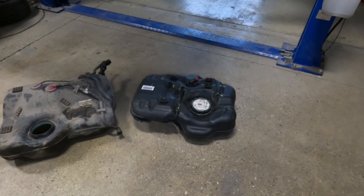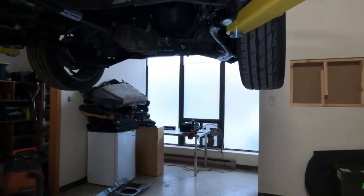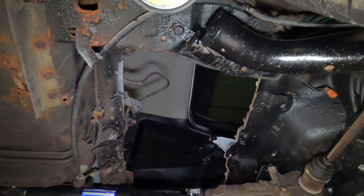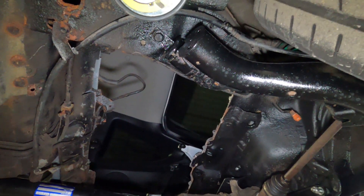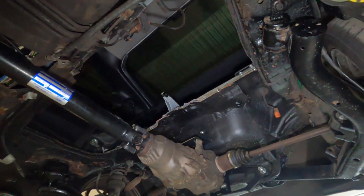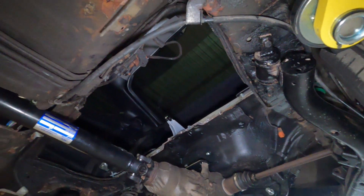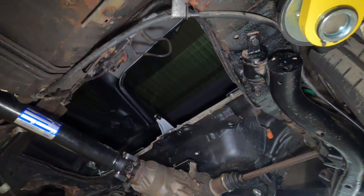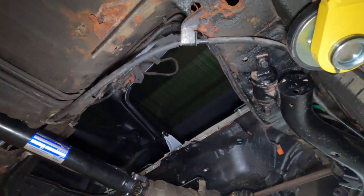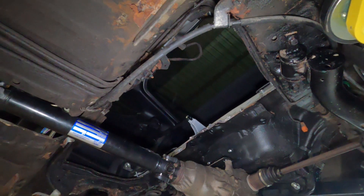Let me show you how this gas tank fits in the car. Before I do that, I should go through what I've done to the RSX. In the previous video I did mention how I kind of ruined the car — joking — but I did cut out the whole bottom seat area to try to make another gas tank fit and also just to make life easier for test fitting. Because I've done this, it will make it easier to see how this tank fits inside. If you want to use this gas tank, you are going to have to modify the floor pan — or seat pan, I guess it's actually called — in the passenger seat area. I've cut all of mine out and I plan on redoing this whole section in flat sheet metal. This is what it looks like now before I put the gas tank in.